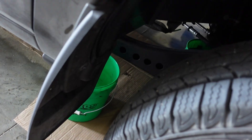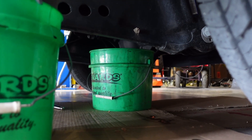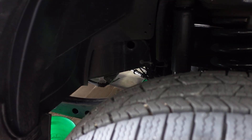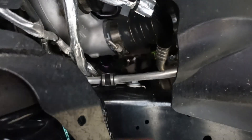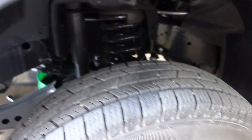It does not come with a new O-ring for the drain plug, which is kind of a bummer because those can be a pain to find — usually a special order. You can see I've got my three-gallon bucket under the truck and it fits perfectly. You can fit your wrench up in there to get the drain plug out and get your hand in there. It's a perfect capacity bucket for doing an oil change on one of these — all in all a pretty painless oil change compared to all the previous years. They couldn't update the front wheel liner though — there's a useless cutout that's going to let mud onto your turbo and engine. But you used to have your oil filter here and taking it out sucked because it's hot. Now you don't have to put your hands on a hot filter, which is nice. I'm really digging this.